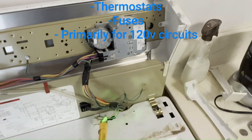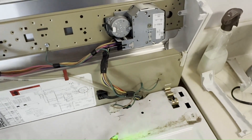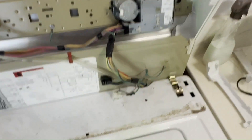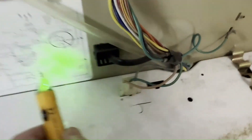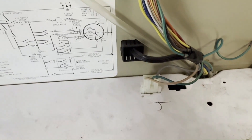I could just take this out and do a continuity check, but this video is about the theory behind it — how you can readily and effectively test the continuity across a component by using a voltage pen in a 120-volt circuit.